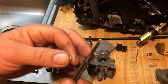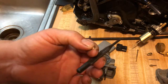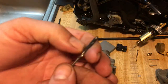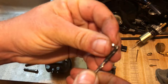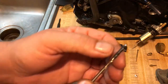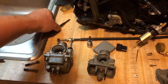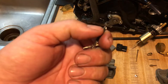I showed the removal tool in one of my other carburetor videos, and I got a lot of questions asking if there's another way to remove it without buying that tool. There is. Take a drill bit, put some electrical tape around it leaving about an eighth of an inch exposed. Drill all the way through, then use a self-tapping screw in the center and use a pair of pliers to pop it out. Leave an eighth of an inch — use the electrical tape as a guide and don't go past it, or you might go into the idle mixture screw and mess up the threads. The alternative to the specialty tool is a one-eighth inch bit marked at one-eighth inch. Simple.